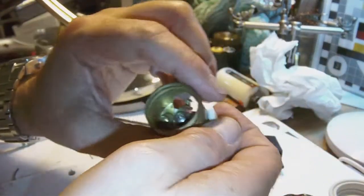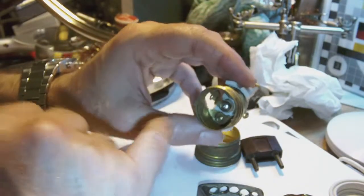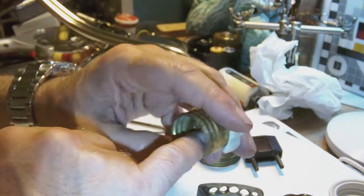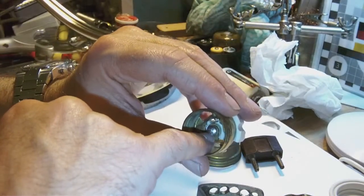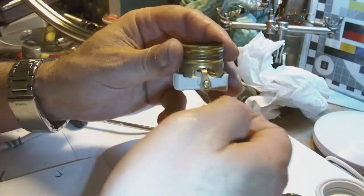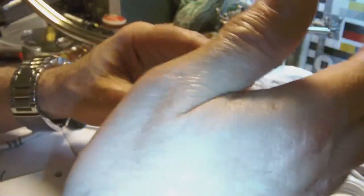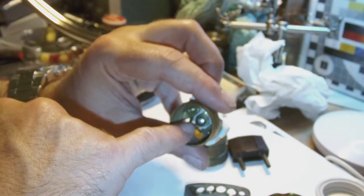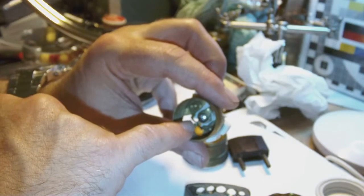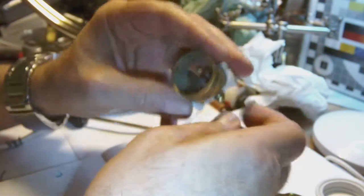And then I also had to repair the fitting for the light bulb, especially the center of the socket. Okay, so the socket still had its contact for the center pin, but somehow, somewhere along the way, the center screw for the socket was lost. Well, in point of fact, this was dangling around and was fortunately not lost. So I had to replace that as well. That turns out to be a 2 millimeter screw. So again, I used a stainless steel round head screw and fitted a small 4 millimeter nut at the bottom, and that will do nicely.